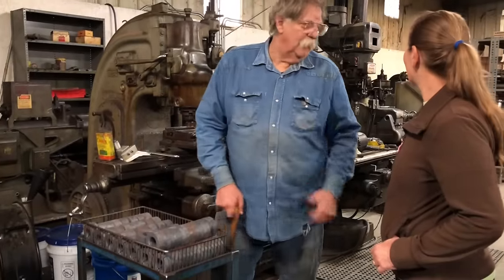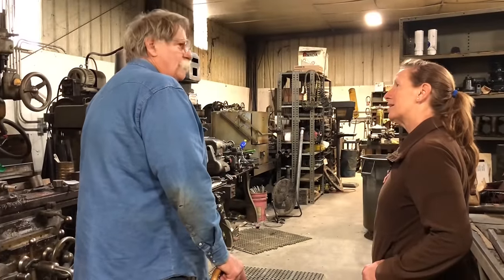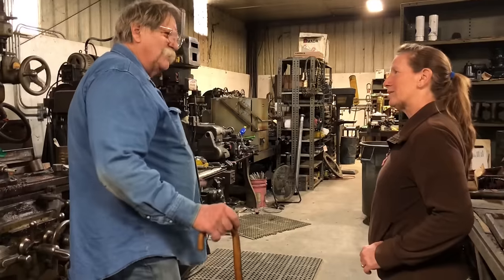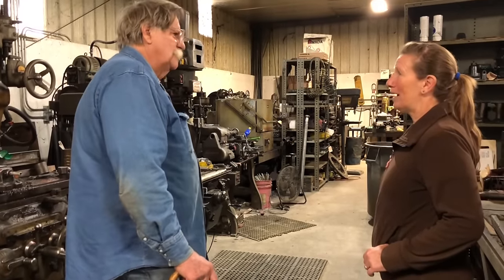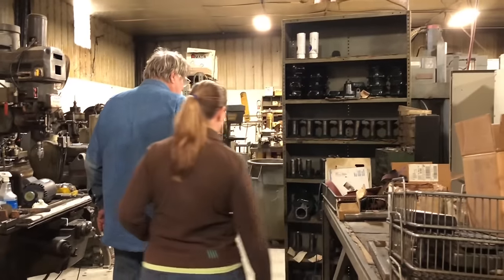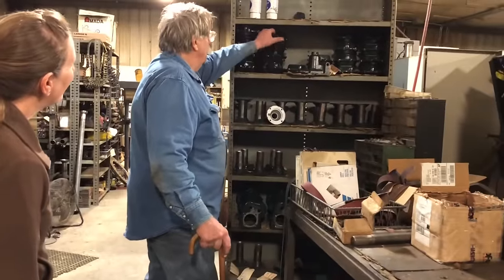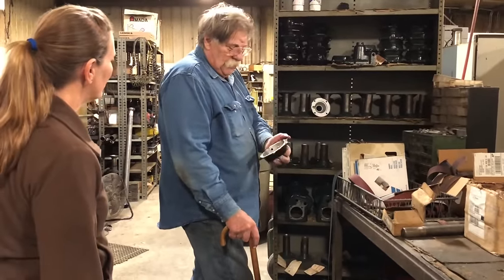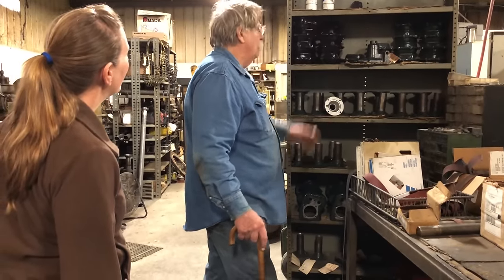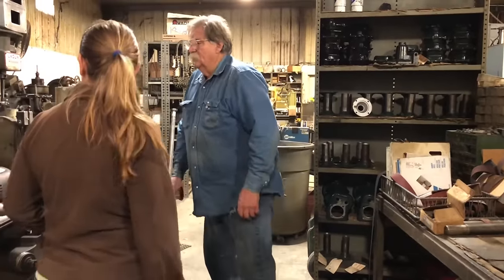We size them, stress relieve, broach, then finish them — very little distortion. We still lap everything in. We used to have more bodies to work on parts. Before COVID we had nine people plus Indiana, eleven of us, and were down to six-week lead times. After that it just went to parts waiting. Customer parts include front bearing retainers and rear bearing retainers — there are two styles, early and late. We color-code them, sandblast them, and put them together.